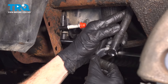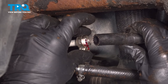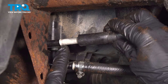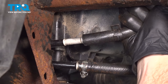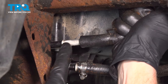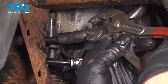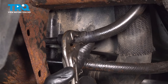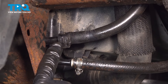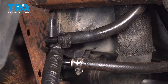Now we can remove our protective tape from along the bottom of the hose and put this onto the cooler. Get that cap off and recycle or reuse the clamp. Take the hose and slide it all the way onto this area. Once done, take your brand new clamp and slide it into the proper position. When pressing this onto the cooler, I like to reach around the front side and hold the cooler rearward while I push the hose forward. Make sure you can still see some hose on both sides of the clamp — you don't want the clamp at the very end or the hose could come loose.